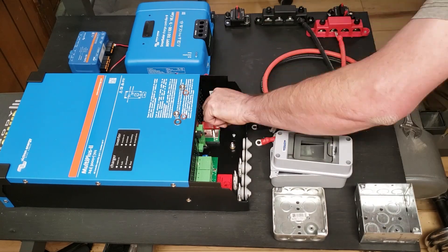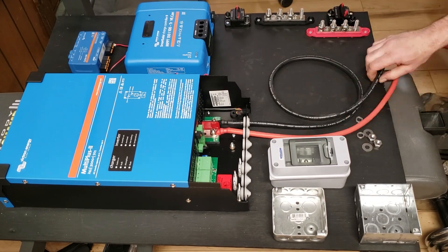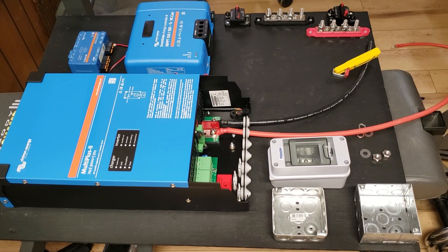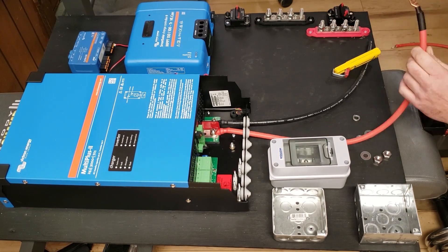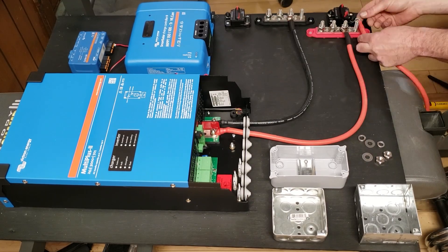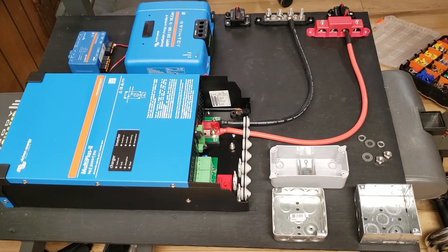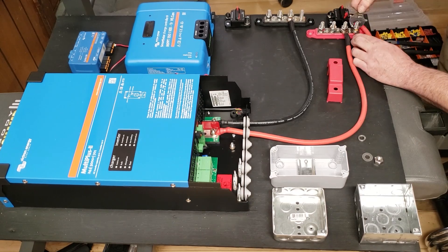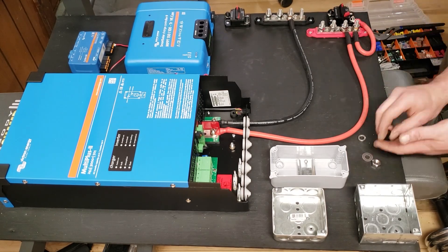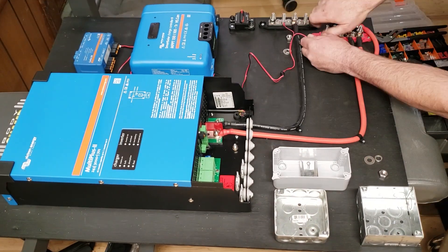I went to work getting my cables attached — the positive and negative that are going to feed to the battery itself for battery power — and trimmed those cables down to the appropriate length after I had my bus bars and everything else where I wanted them. I'm using a 300 amp resettable fuse here basically as a disconnect to the battery. But the lugs on that are just not beefy enough for this application, so they'll probably get replaced eventually. I was going to run one short wire across to it, but they were a little too close together, so I just did a loop.